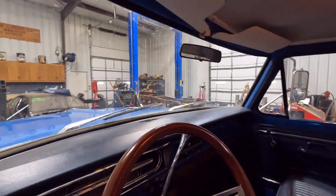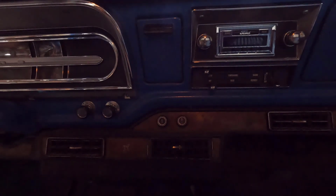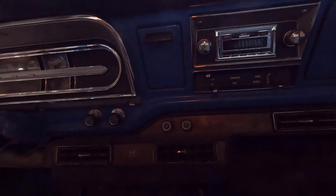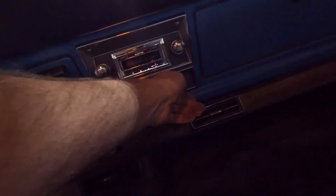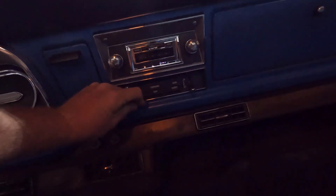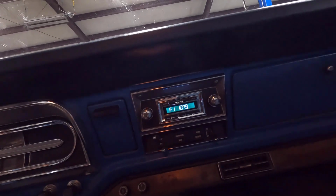So those all work. Now in here on the air conditioning, it has a 3-speed blower switch, but only one of the speeds is working. The first speed is not working, and then the second speed it comes on. So all the speeds aren't working, but I found that speed to work just fine. So I just left it be. Now on the heater, all 3 speeds work, as do the heat controls, defrost, and your temperature slides, obviously.